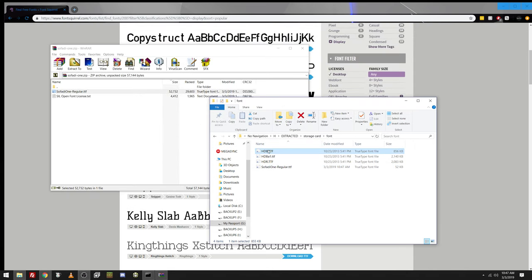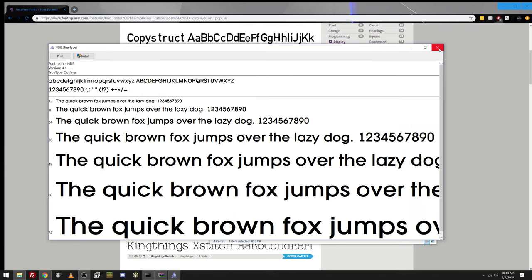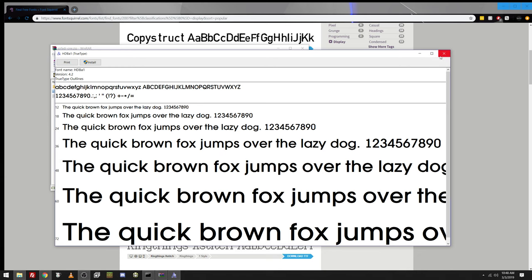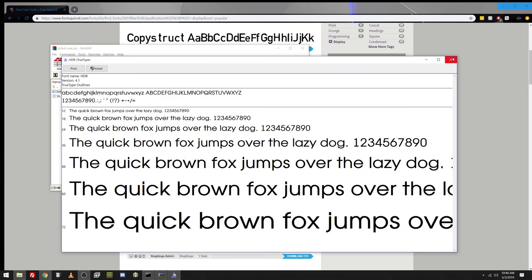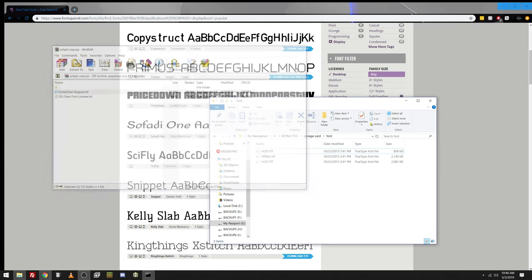So what you have to do is basically rename that and then rename this hdb.ttf. And then put this on the head unit, which I'll have a tutorial for much later down the road for you guys. But you can put this on the head unit, and then once you turn your car off and turn it back on, this font file will be loaded into memory instead of this one. And from there, you'll actually get this font on your head unit instead of this, where this one specifically is used. You'd also have to replace this one and this one to get the effect basically everywhere, because three different fonts are obviously used everywhere. So that's just a quick tutorial for you guys, an example of how to replace something.